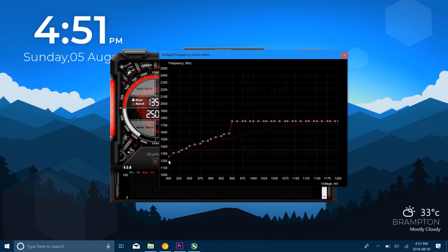As you can see, this is the custom curve I've created for my undervolt process. I want you to copy this onto your GPU, but keep in mind you might have to make small adjustments. Remember two things: first, these values will take you time to set up so pause as needed — accuracy is key, especially on the high peak line, which has to be super straight and not jittery, as jitteriness can affect performance. Second, every laptop is different — my silicon and cooling system are different, and everything varies.